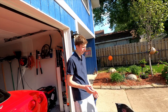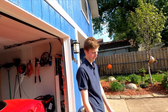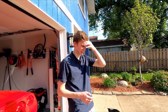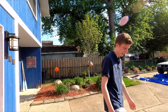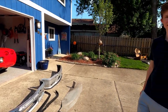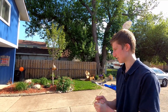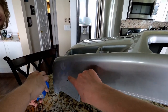The OEM bumper has holes for the skid plate and for the OEM splitter, which are not on the eBay bumper, so we're going to mark and drill those holes. It comes with fog lights — same brand as the black ones we showed in the other video, but these are clear. We painted it using MS 42 clear coat and the color is Titan Silver Prime.